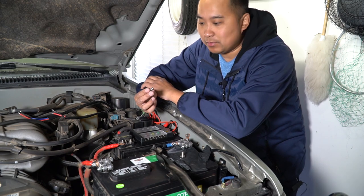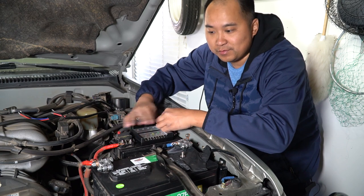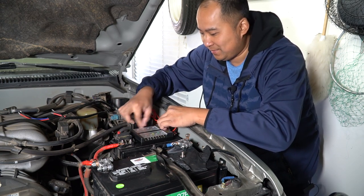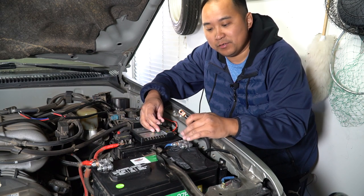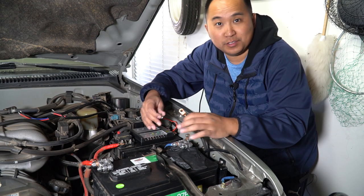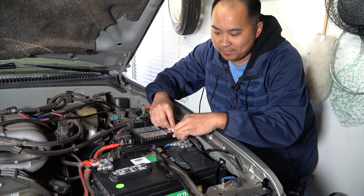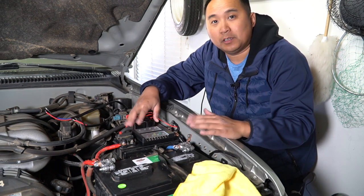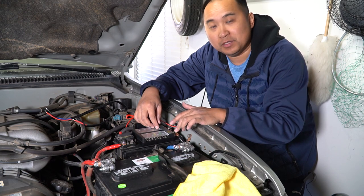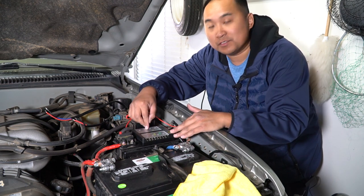I'm going to hook up my 100 amp 4-gauge wire to this circuit breaker — it's the same wire I had before. I made a new wire to go from this side over to here since it's a different location than the Blue Sea box. They supply bolts for you to connect to the box. The breaker is off and I have the negative disconnected as well. For my ground wire, I made a new wire that goes to my marine post. You can easily use the existing stuff provided in the kit, but I'm going to use what I already have.